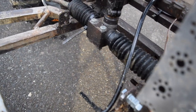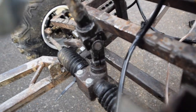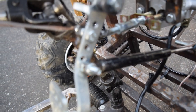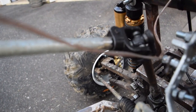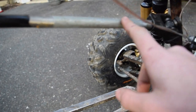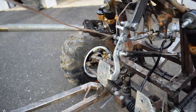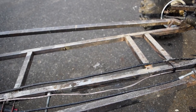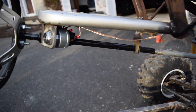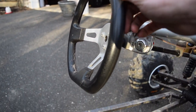Moving to the steering system — spider box rack and pinion with standard knuckles. I actually cut off the splines that originally came with the shaft and took 5/8 inch bar and welded it in between to lengthen it, because at one point I cut this go-kart in half and added six inches to the overall length since I grew. The flat bottom steering wheel is 11 inches, which is perfect for what I'm doing.